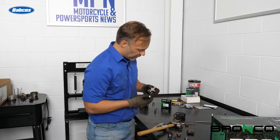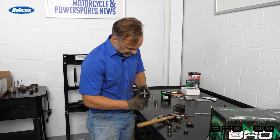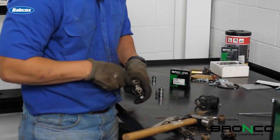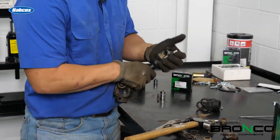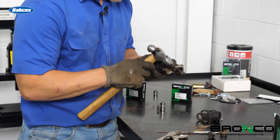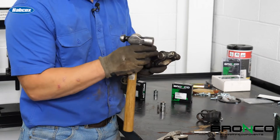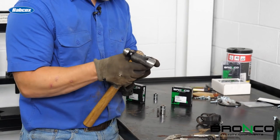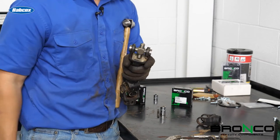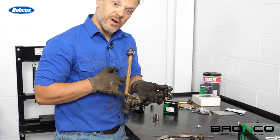There's the new one here. I've got the caps off of it. What we want to do is slide the cross piece basically in the center there, and then we're going to stick the caps on each end — push them in as far as you can with your thumb. There are a couple of ways to press them in the rest of the way: you can use the press, or you can use a hammer and tap them in lightly, as they should slide in fairly easily. Just make sure that you hit all around the outside and that it has good smooth movement the whole time — that tells us everything is lined up and we're in good shape.